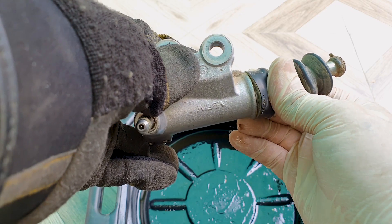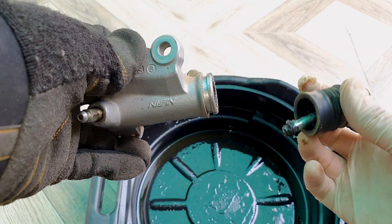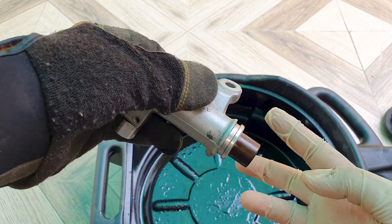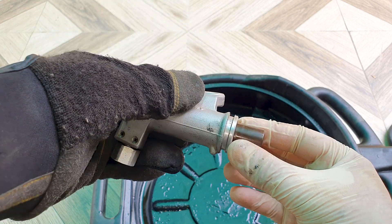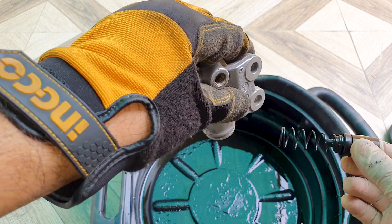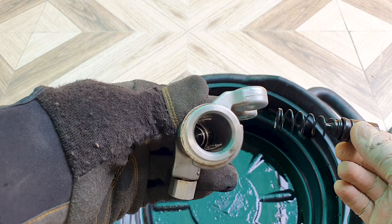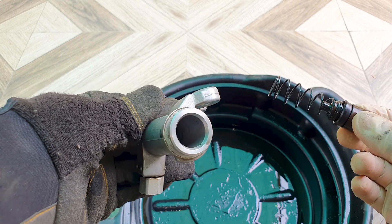Remove this boot off the slave cylinder. I'll try to get this piston cup out. What I ended up doing was I just slightly tapped this area on some stairs and it came out. I don't see any rust — a little bit of dirt or whatever that is, maybe a rubber material — but it is rust free.